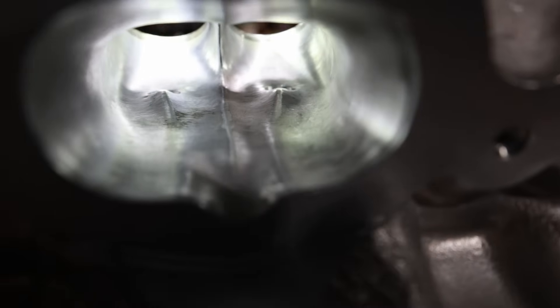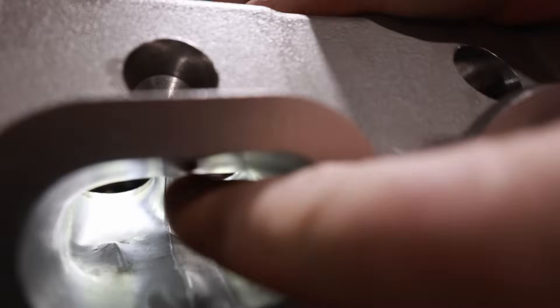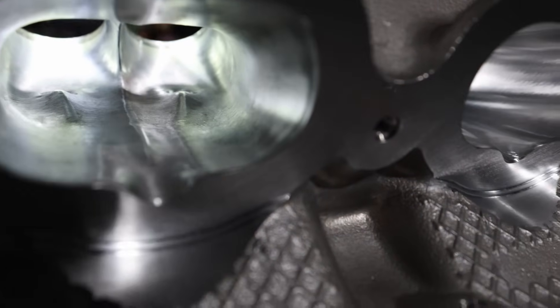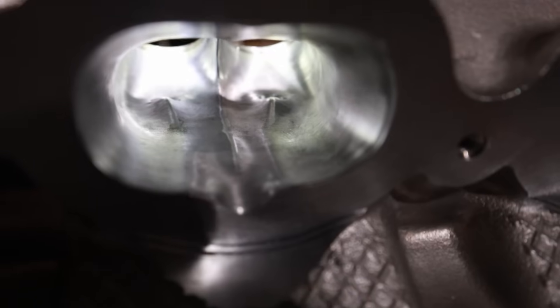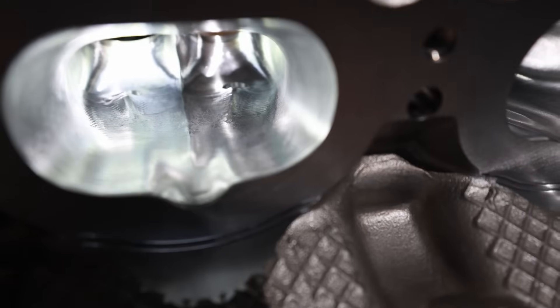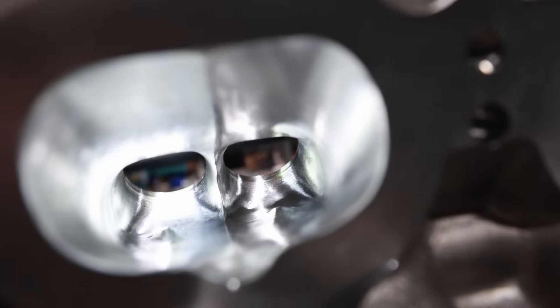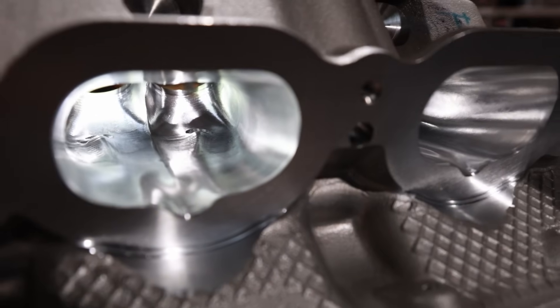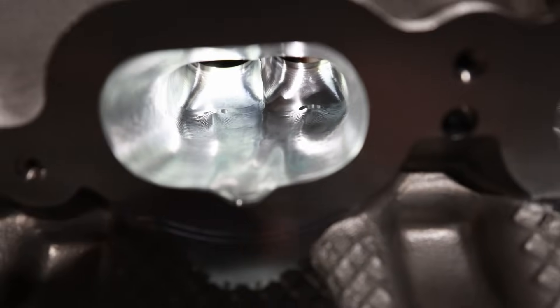All right, so now here is the hand port that Matt digitized. You can see my fin in here — I put a fin on the roof, I put a fin on the floor, I made the guide bosses into fins. The CNC barely touches, so you can see a little bit on the wall here, but it barely touched. You can tell that this thing is accurate to size — what Matt did is very accurate. And let's take a look over here — look at that CNC port, looking delicious. You just want to eat it. You can see all the fins and all the features that Matt had to digitize from our hand port are still in there.